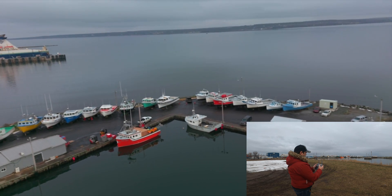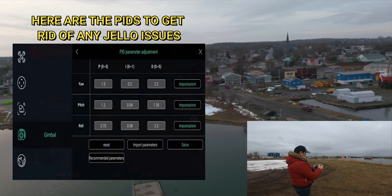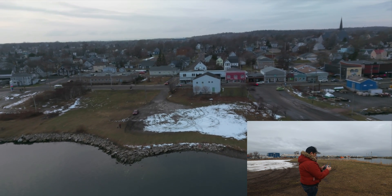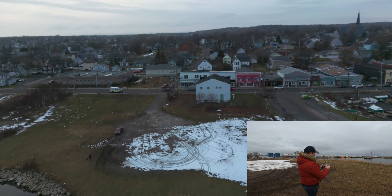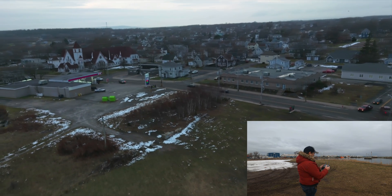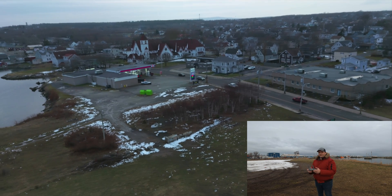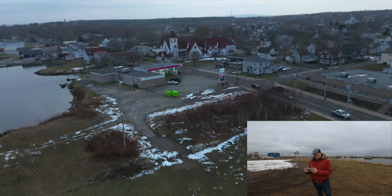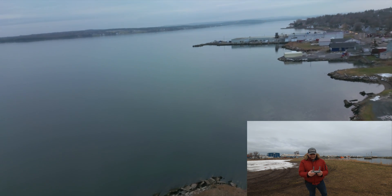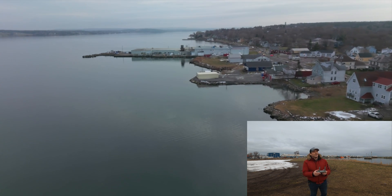Hopefully that corrected the issue. I'll try and take a screenshot of the PID tuning to put up on screen. So you guys that are experiencing any jello in this drone can put those PID tunings in — adjust your gimbal gain, that's where you put those in. You go to your gimbal settings, Advanced, and change the gimbal gain. It'll say PID and there are three of them, so I guess it's for each axis of the gimbal. You'll see it when I put the picture in.